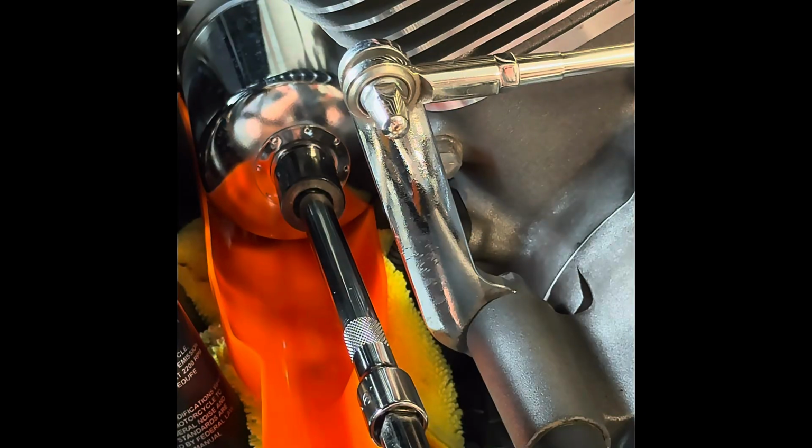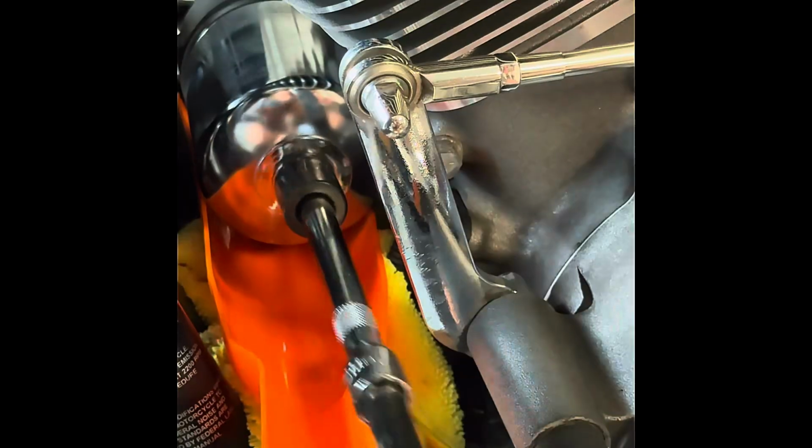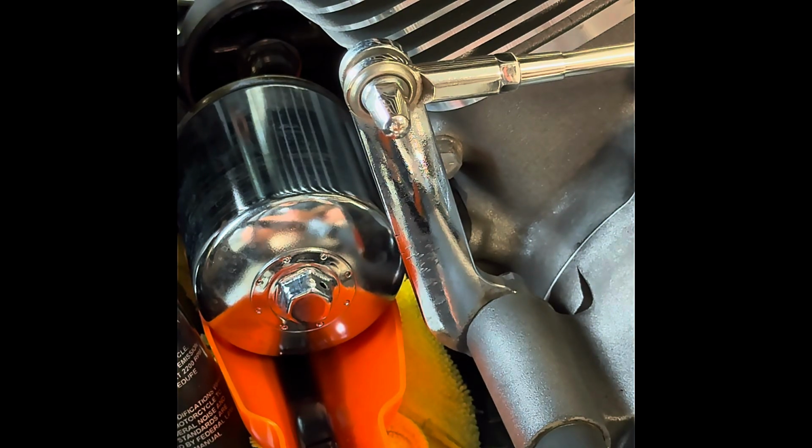So guys, we're going to go ahead and move forward to remove the oil filter. Mine happens to come with an 11/16 nut on top to be able to remove it easily, but most of these could be removed by hand. If not, they sell tools for them. I also put a little microfiber cloth in my oil funnel to avoid a huge mess. I did loosen it a little bit prior to starting the video, just for time's sake. I use a plastic container underneath to collect any oil that comes out. And we'll let that finish draining, clean up, and just go ahead and fill everything up, and we'll talk about that in a second.